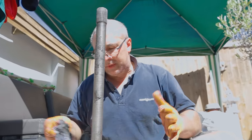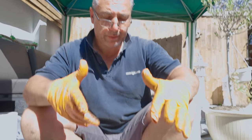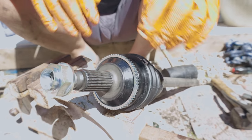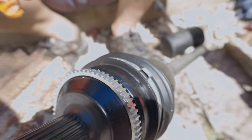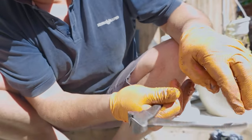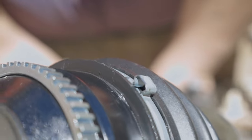This is very easy to put on. I'll show you the clip before I squeeze it on, just to save a bit of time. We've got the boot back on, we've got the ring back on, ready to crimp up. Quite important whilst putting the boot on — there is a rib on the inside of here that the boot actually sits into. Make sure that's in so you've got a nice seal. Then tighten up as much as you can so it goes into these little clips as tight as possible. Then we crimp this section here to tighten it up, and hopefully she'll be all good, tight, and water resistant. These are my old ones — they used to be Dad's, he was in the RAF. They're for pulling nails, but they work really well for this job. And they just close it up nicely — like so. That is solid. Nice and tight.